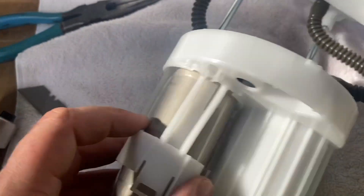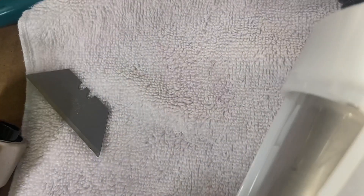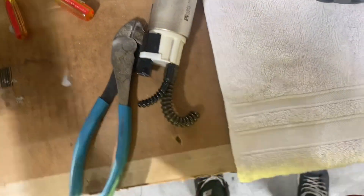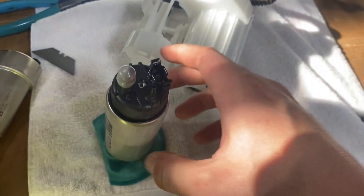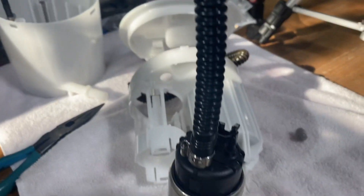Test fit it there - so that's inside. We'll pull this back out and throw the sock on there. I remember from before that we had the electrical connector pointing towards that line, so that's going to be the orientation. Got our sock on there - that one definitely takes a little bit of elbow grease, so just take your time and don't force it. I may go ahead and install these clamps while I already have the pump off so I'm not trying to wrestle it while it's in there, and I'll just feed them through the top.